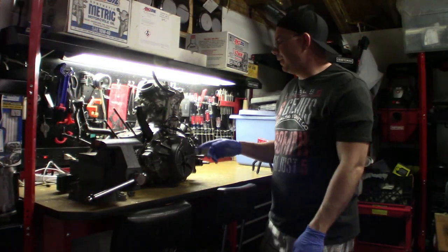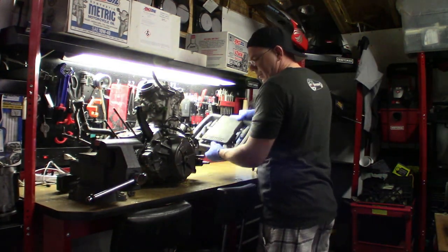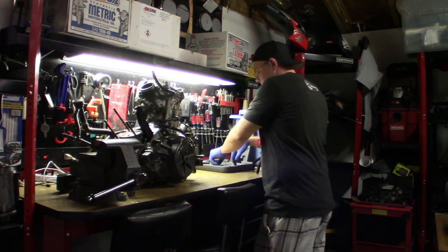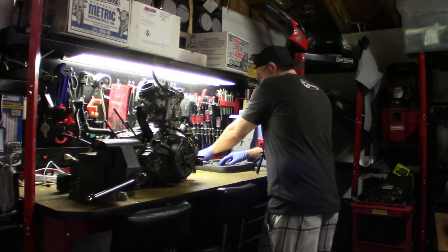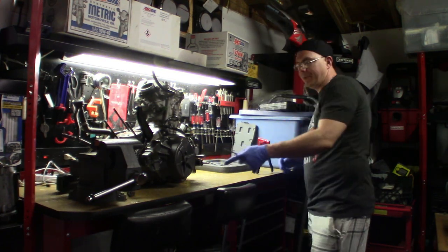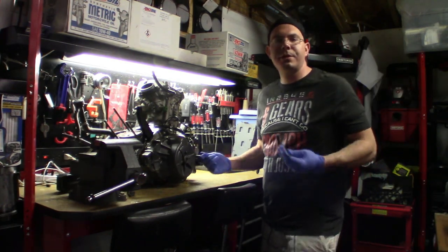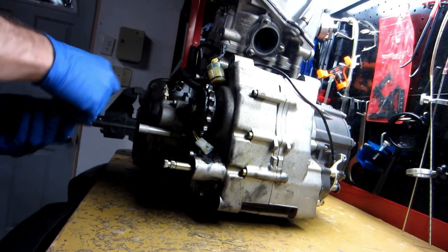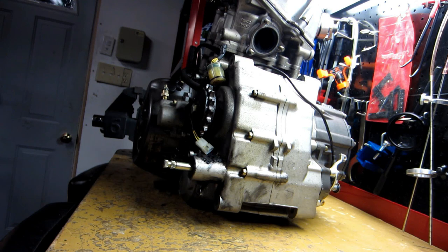When you go to pull this off the bike, it'll be on the sprocket side of the bike, and there'll be three, well, I believe they're Allen heads. You'll have to remove all three of the bolts to get it off of here. And one of them, you'll see here, is the spacer for your fairing, so it keeps the fairings from bopping up against your engine. Make sure that piece goes back on. We'll just remove that bottom one first. And don't lose all these parts. You don't want to have to replace these bolts.